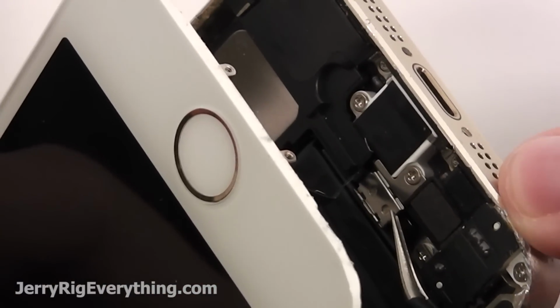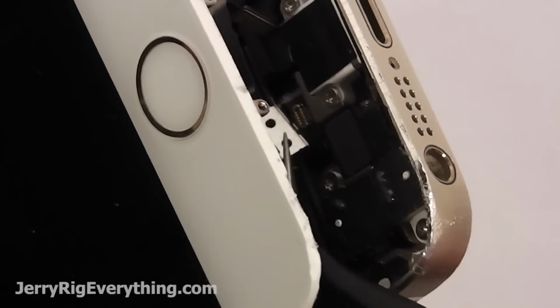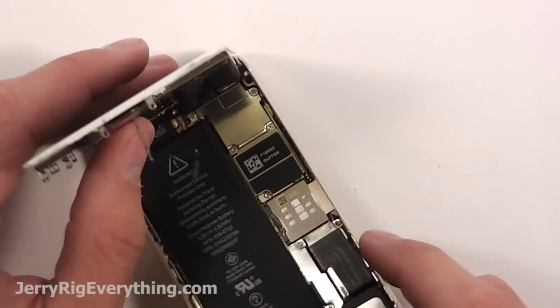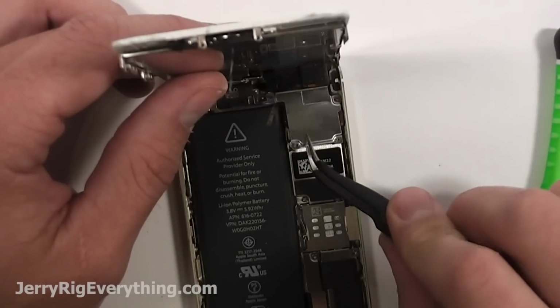the screen. There's a little metal piece attached to a ribbon cable down here, so lift that off and then unattach the ribbon cable from that little clip down there at the bottom. It's similar to a Lego, so just unsnap that and then the screen will lift up. Make sure not to fold it past 90 degrees, otherwise you'll damage those ribbon cables. Take out the 4 screws that's holding down the metal plate.